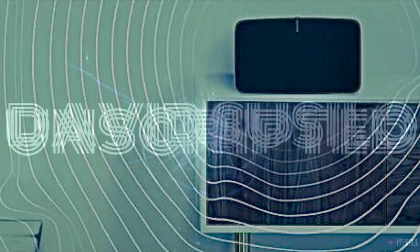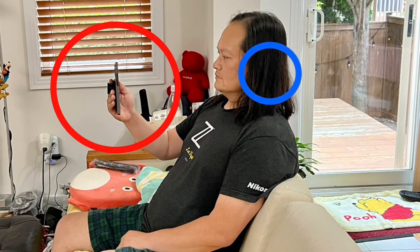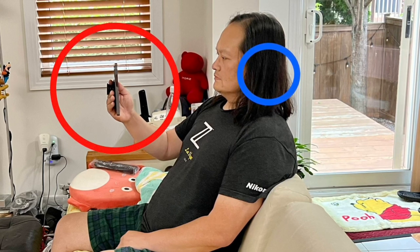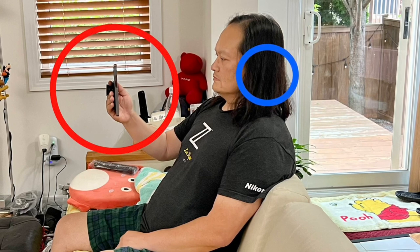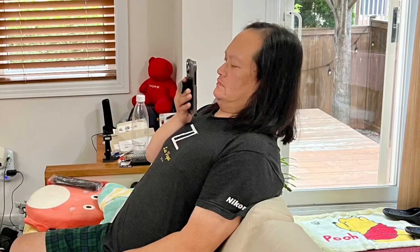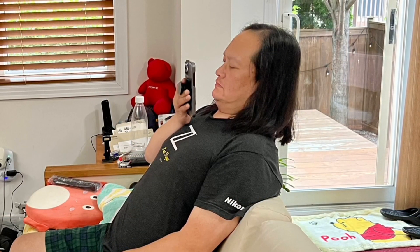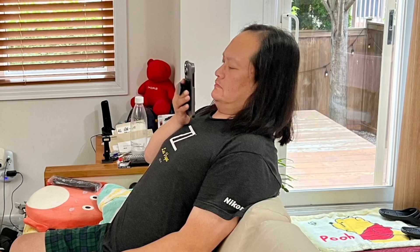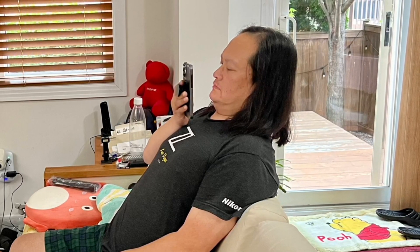And now, my TruePlay tutorial. In the instructions of TruePlay, it tells you to put your phone in front of you — don't do it that way. You should always calibrate from the point of where your ears are. My suggestion is to push your head as far back as possible and put the screen in front of you, just like this. I have tested this method in more than 20 Sonos home theater systems, and I consistently get a better result — better envelopment in the sound reproduction.